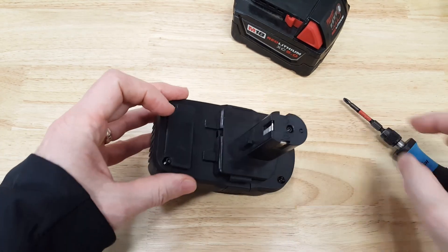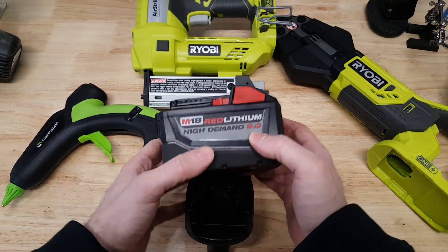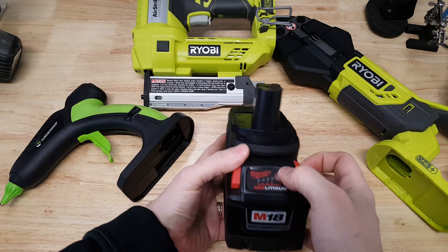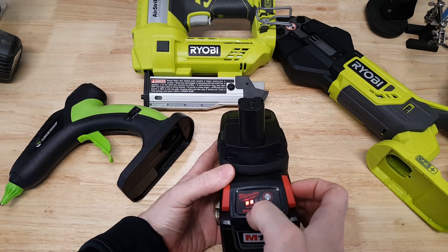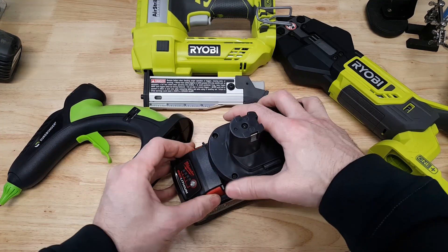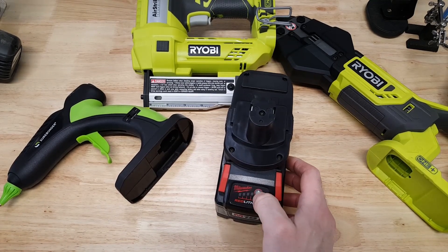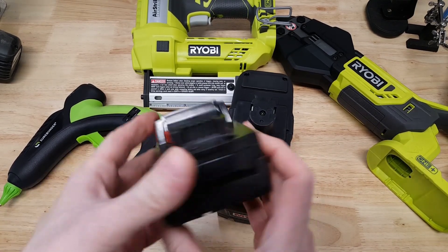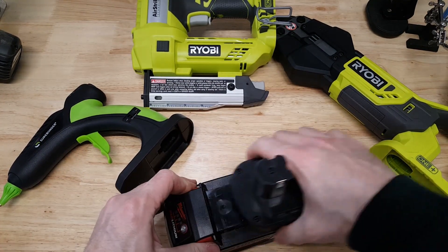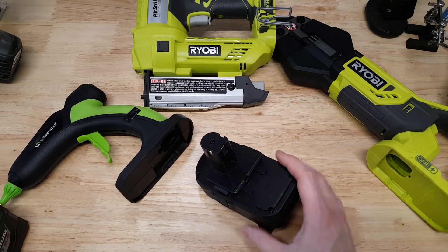That closes up nice. On the nine amp hour battery, the 17.6 volt cutoff might be a little bit high — the low-voltage cutoff is happening at two bars on a nine amp hour battery, so 17.6 is very, very safe. It will only run a nine amp hour battery down to two bars, and a five amp hour battery down to one solid bar. I don't know what it will do on a 12 amp hour battery, as those have different cells.